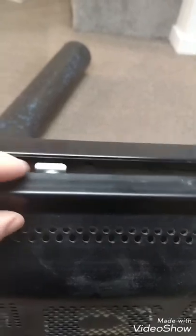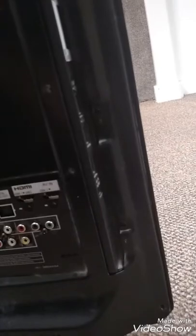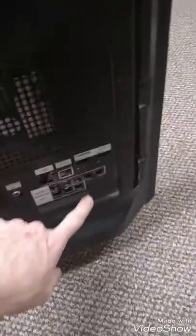Up here there are clips, and your TV lip will hang just over the edge of those, so it's kind of hard to pull — just give it a little pull. Not too hard or you're going to break it. If it feels like too much resistance, let it go. Once you've unhooked them, you should be able to pull it apart. I had a little trouble — I had two bolts I forgot were right there. Like I said, if there's any resistance, don't pull too hard. Once those are undone it just pops off and you have access to all your boards.